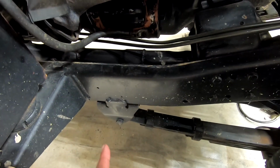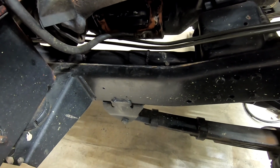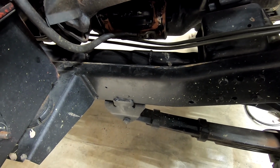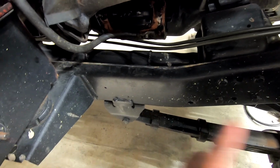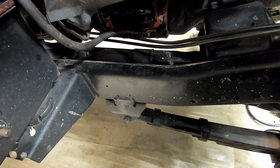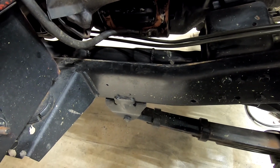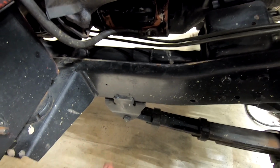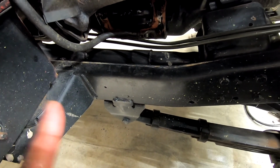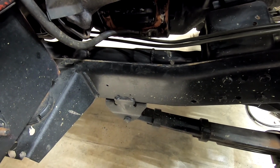Okay, I was kind of wiping the frame down, and I realized that I had spray all the way down this pipe. Well, I thought, there must be a hole behind there. Well, there's not. But what happened is my straw went in a hole and popped back out of the frame, and I sprayed all the way down that thing. So bear in mind when you're doing this, you want to make sure that the straw's actually inside the frame that you put it inside of, instead of poking back out somewhere. So there's a spot here that I missed, so I'm going to go back and redo that area. Plus, it says you don't want to get it on exhaust because it could catch fire. So just a little quick tip there.